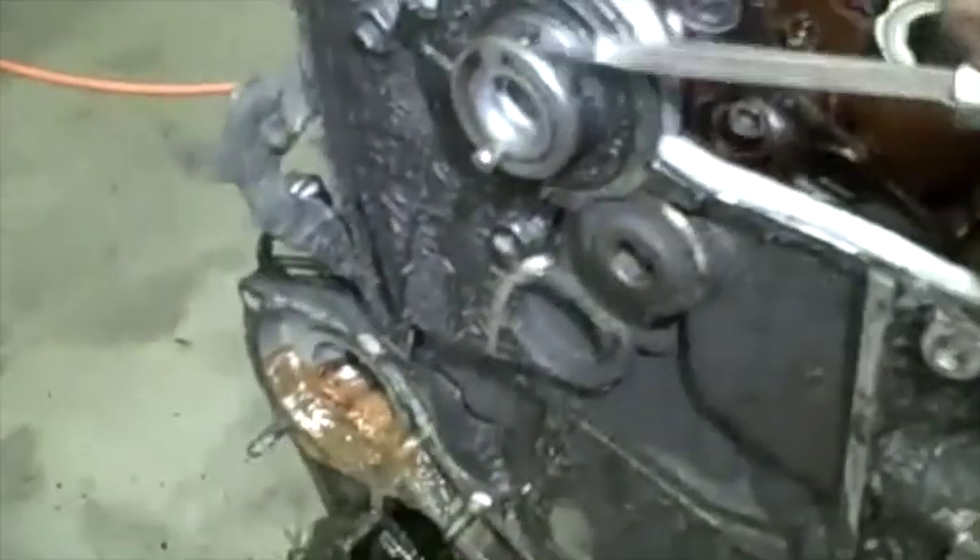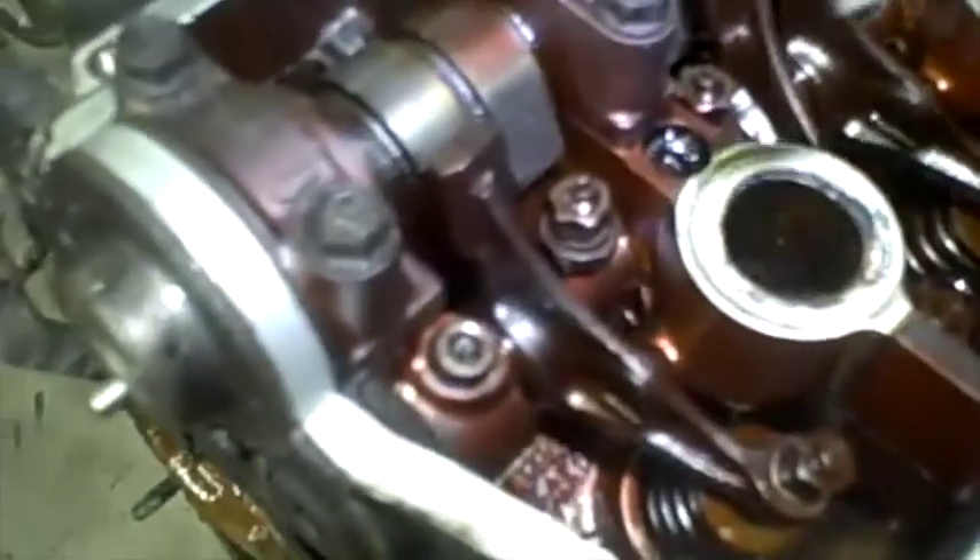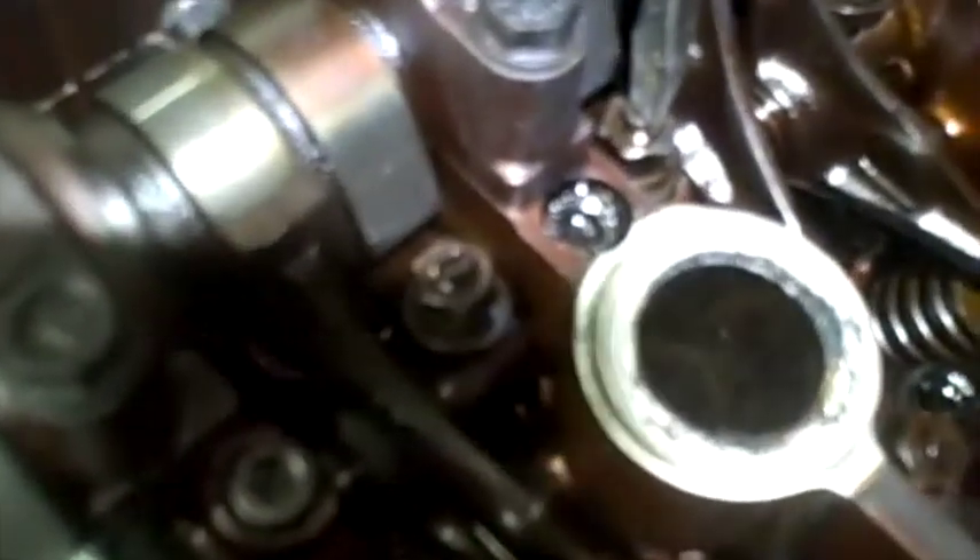Got the pulley off. I used my size 10 wrench and loosened up all of these adjusting lock nuts, and then I loosened all of these valves — so every valve has play in it, they're all loose.